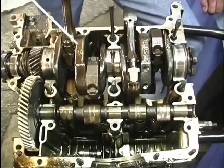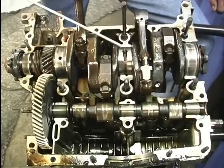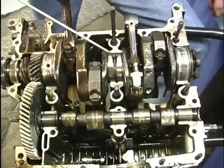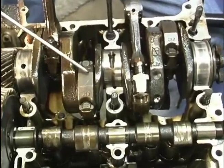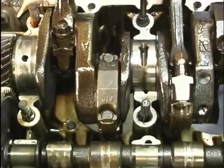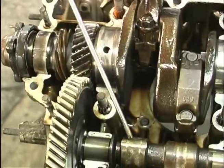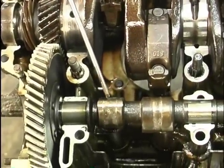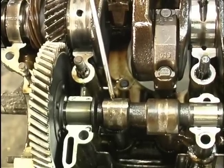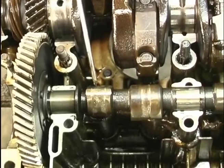Now we're down to the vital organs inside the engine. We have the crankshaft here with four connecting rods, just like a Type 1. It has almost the same bearings, but the Type 4 bearings are a lot bigger in diameter and the width is also just a little bit more. We have our camshaft here, and this one was a hydraulic lifter engine. It's showing a lot of wear on this number one lobe, and that's what normally wears. You can usually judge the whole cam by this one lobe, but it's always really good to check them all over.